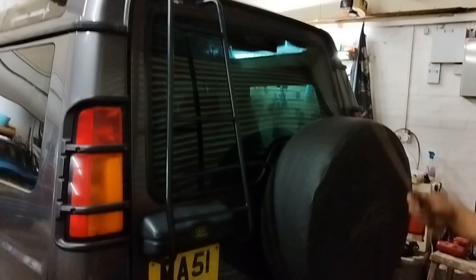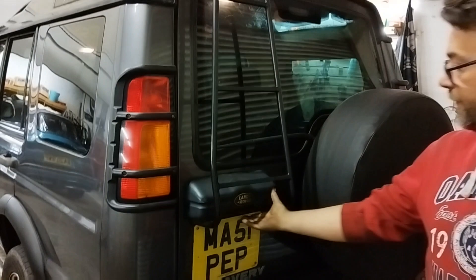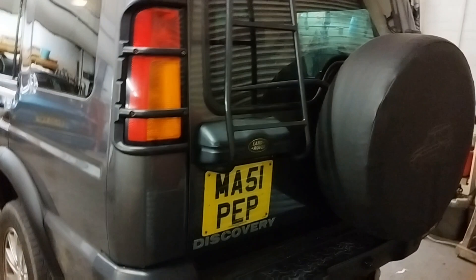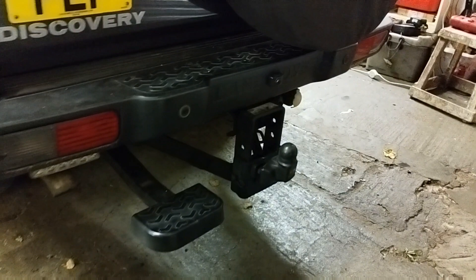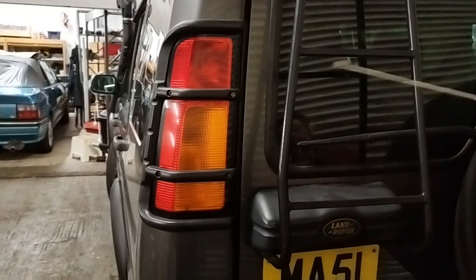Check your boot door round the back. These have a tendency to stick — the handle doesn't work and you have to pop it out and fix it inside. Check the rear bumper — they get reversed into things. Also check the step: they always go because they rot off. There's a little gas strut mechanism that rots off, so the step no longer goes back up. Check your rear lights for cracks, and check your rear window wiper blade — if there's no blade, when you put the car in reverse the wiper comes on and will ruin your back window.